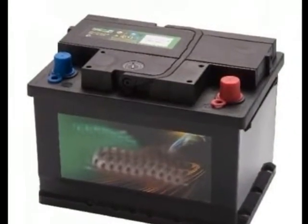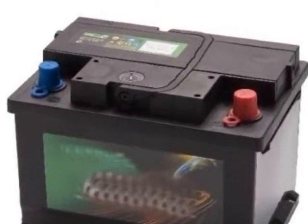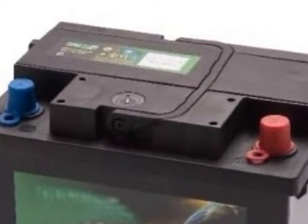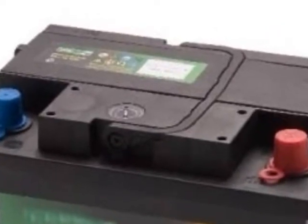Be careful if you notice that the fluid level in the battery is getting down, because a flat battery will absorb a lot of the liquid. If you top it up when it's flat and then charge it, the liquid will overflow, and if the battery is still in the car, this is what happens.